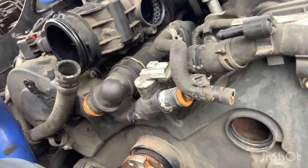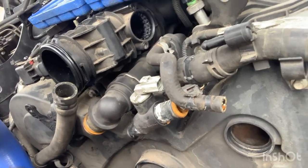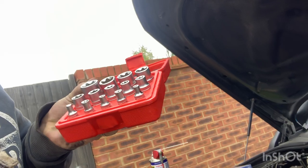Okay, so I've just stopped the time lapse because I found a really important thing that I've forgotten to mention earlier. To get the flywheel pulley off and the water pump pulley, you're going to need Torx sockets. So I bought this little Torx socket set on eBay for not much money. I will put the link in the description, but it's really, really important.